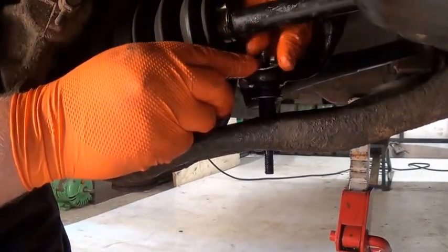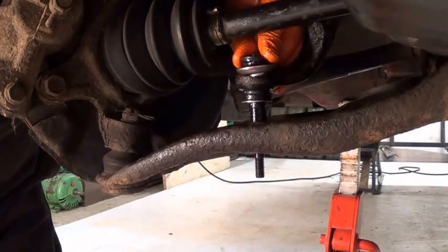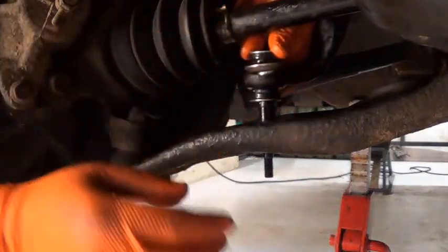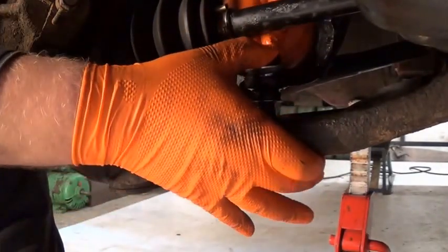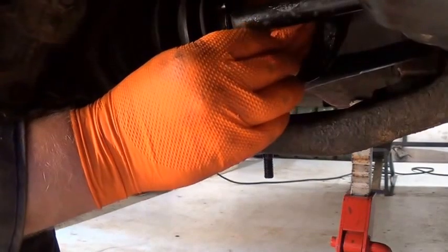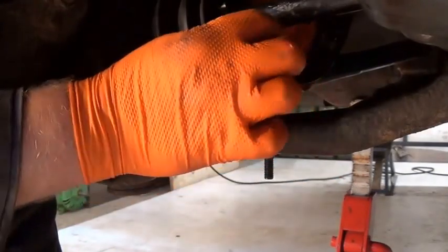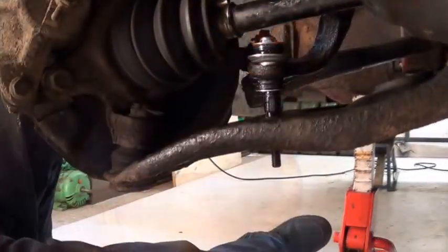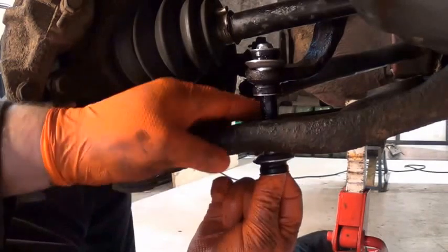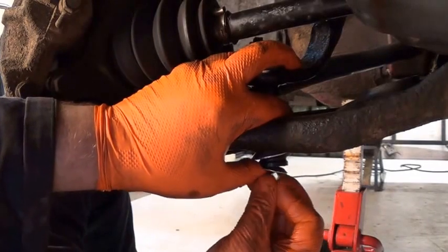Metal dished washer goes in there, and the rubber on top. And then there's a small washer, which I can't pick up because I've got grease on my fingers. Small washer goes on the top. And there'll be a nut on top of there if I can compress it enough to get that on. Put the nut there. Okay. Same thing underneath, same arrangement of washers and bushes, and then a nylock right on the bottom.